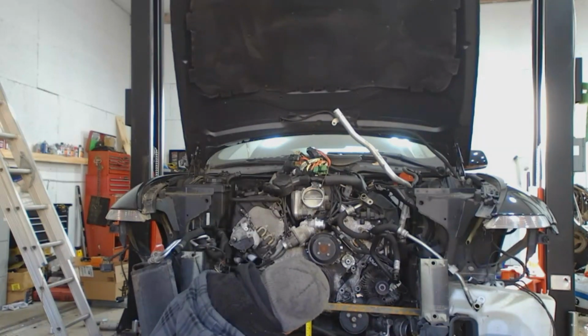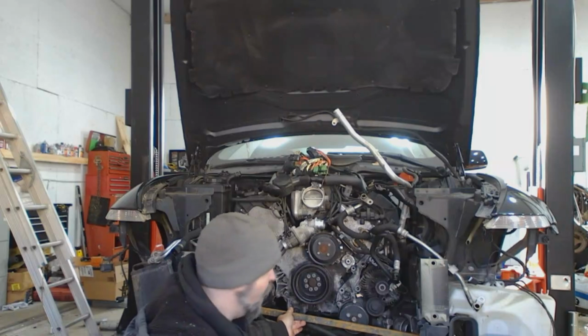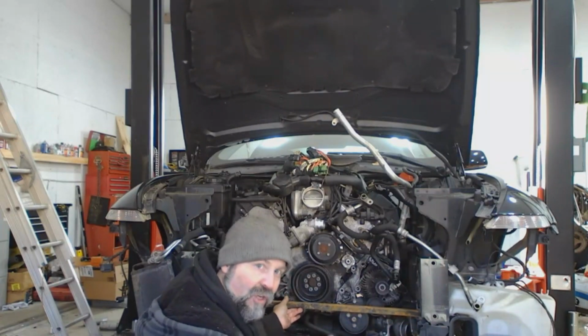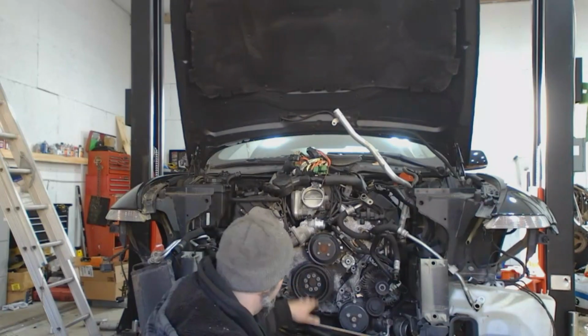And then my crankshaft center line is roughly 2 1/4 inches above that line. So 2 1/4 inches above the flanges underneath the frame horns. So when I put my LS in there, I'll see if I can match it or better.